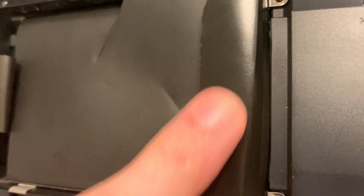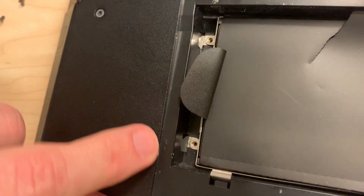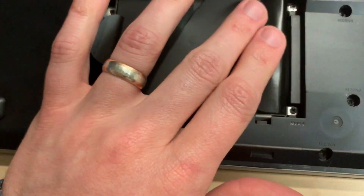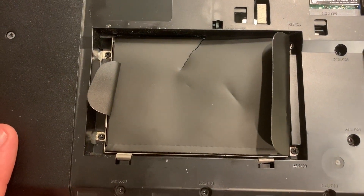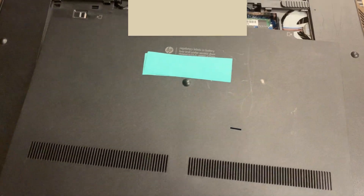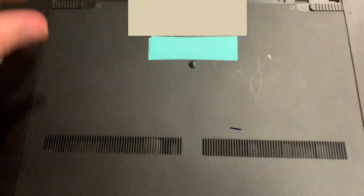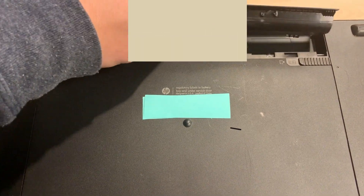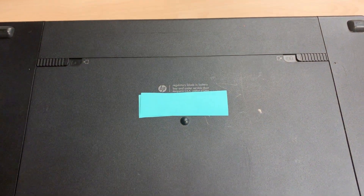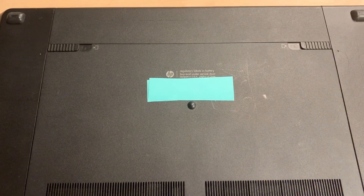All right, it is seated in place all the way. We're going to put these four screws back in place. The SSD is installed. Now we just have to put the cover back on — just like it came off, it slips in and slides forward and snaps. Then we put the battery back in place and it hinges down just like it came out. That's it, we are done. Thanks for watching — leave a comment below, hit the like button, and subscribe for more.